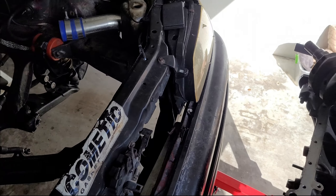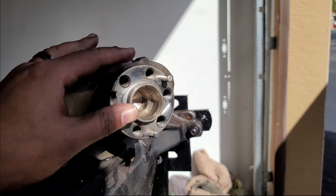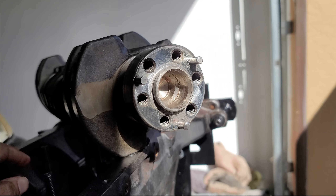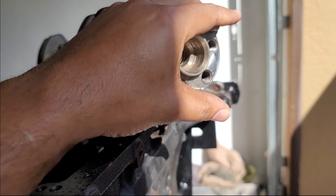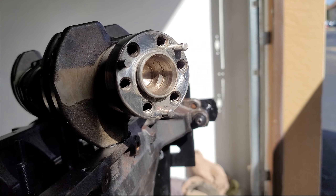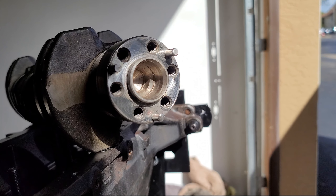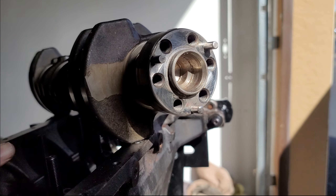Today I'm going to show you what has been done. Not the best work visually, but we have dowel pinned the crank — I've got it machined and dowel pinned. I still need to finish cleaning up some stuff around here. This is necessary because when you get to higher RPM, over 500 horsepower — even 450 — I was first backing out bolts and now I'm at the point where I'm snapping them because they're not backing out anymore.